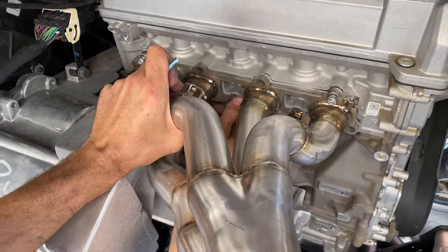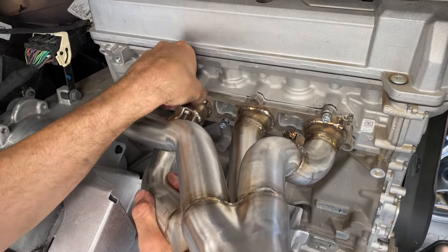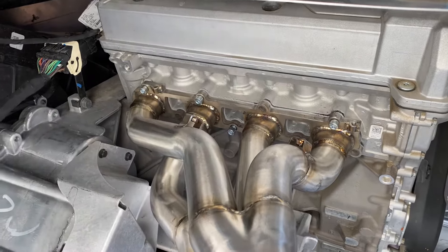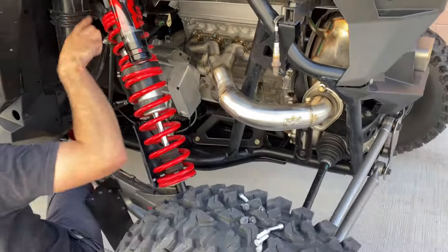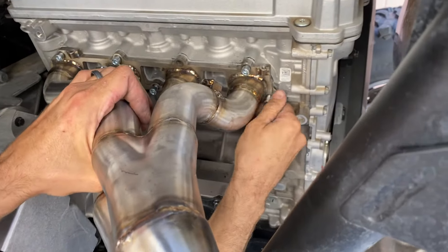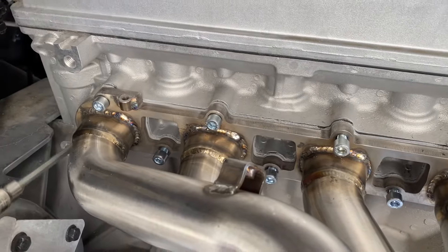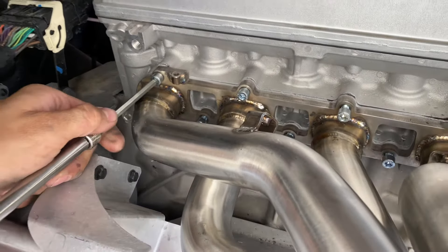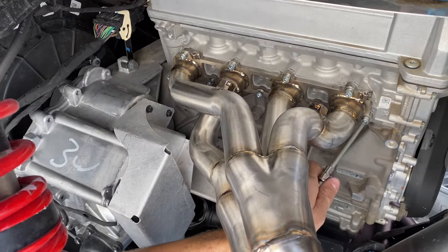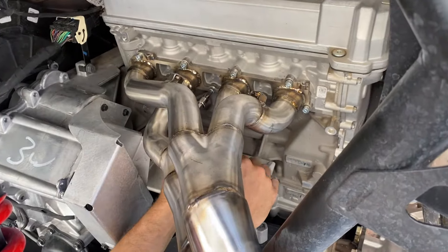Once you've got one or two bolts started, make sure you leave the muffler area loose and you can shake all the hardware in as you need it. Once you get them all started, go back to your ball end and start very lightly tapping them in. You want to use the zigzag motion when tightening all of these. Zigzag across the bolts tightening them up — we have grade 8 hardware included, so snug them up and torque them down.